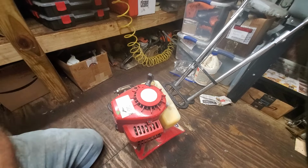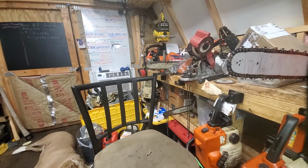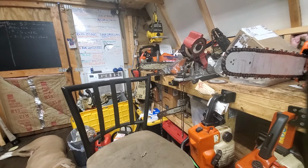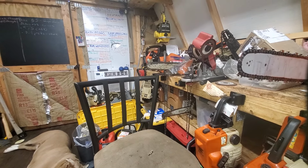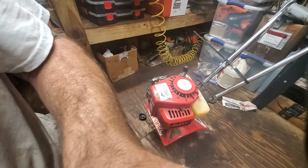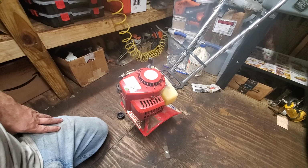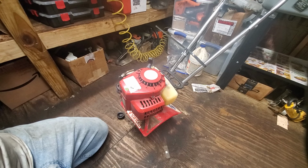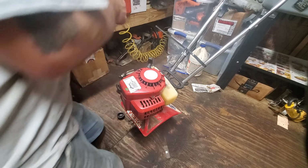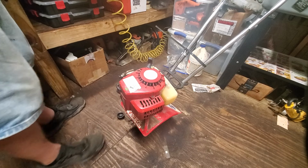I have a blower right now, a PB50 255 up here that I rebuilt. And the IPL on the carburetor says that one of these things is an adjustment screw, but it's kind of rusted and corroded. And I think the coil needs replaced probably, even though it has spark. I think it's not a good coil. Either that or the carburetor itself is bad, because I've rebuilt it twice and went through an ultrasonic bath and everything. And that damn blower, all it will do is try and spark once in a blue moon. But it's getting plenty of fuel, almost like it's flooding out. But I think the reason it's almost like it's flooding out is because it doesn't have a strong enough spark. I pressure tested my carburetor. Everything was good. But that neighbor doesn't want to spend any more money. He doesn't speak English. And so right now that sits until I figure out, does he want to pay his bill and take his stuff back? Or does he want to surrender it and let me tinker with it and hopefully fix it and sell it?